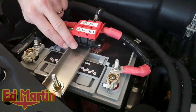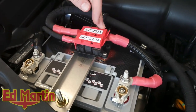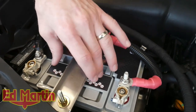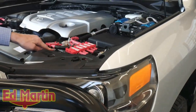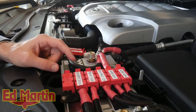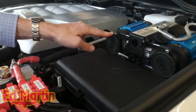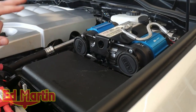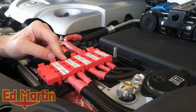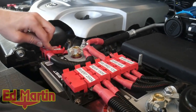We have a couple of different fuses here — we have our BCDC and we also have the SBI 200 amp, which is the SBI 12 RedArc. This is so that we can jumpstart the crank battery from our auxiliary battery. All accessories are wired to the auxiliary. We have an extra here as well as the two for the 40 amp ARB twin air compressor. The Switch Pro, the rear area, as well as the inverter in the back, and the BCDC and the 200 amp SBI are all wired here.